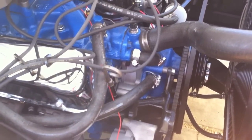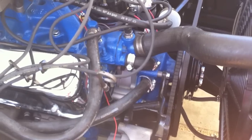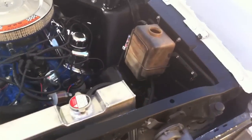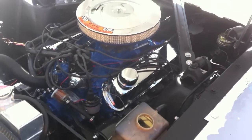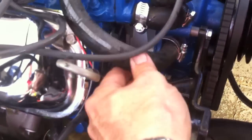After I bypass that, I'm gonna clean her up underneath, wipe down everything, and do an inspection of what it looks like right now. We've also got a transmission fluid leak around the transmission, so we're gonna find out what that is and fix it. The curve on the hose looks good — it's not in the way of anything, not touching the dipstick or its cover. I cut the hoses off and left them long so I can run water through and then pressurized air to empty out the heater core the best I can.